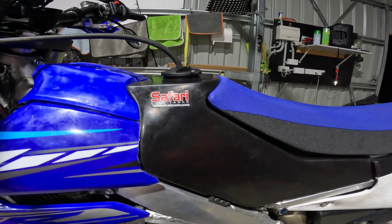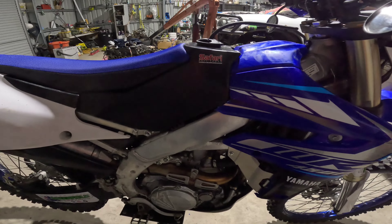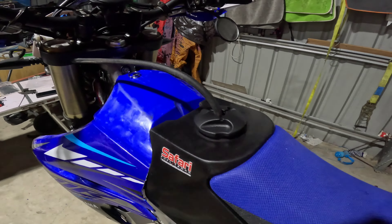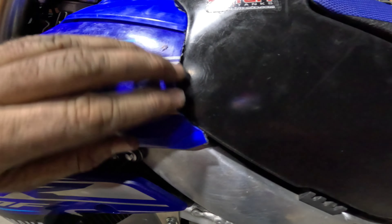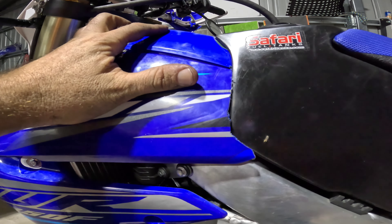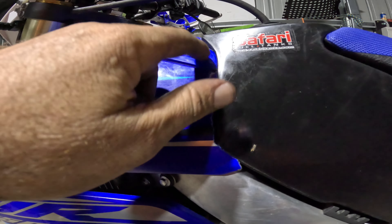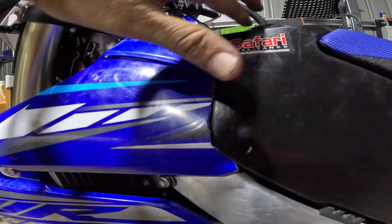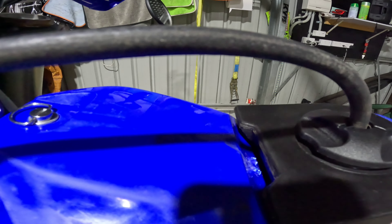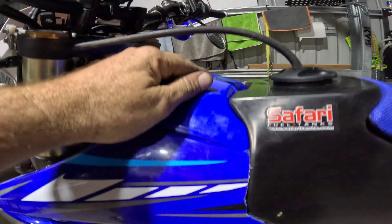There's the final product of it on my WR 2020. I think that looks alright - probably can't tell on this side because it's a bit dark, but yeah, lines up pretty good. Pretty much the same process - I've taken everything off, put it all back together with cutting this up. I will have to cut it a bit more but I just don't have time now, I've got to go cook dinner. On the back of the air filter lid you've got the two clips on either side - had to cut them off to fit because the fuel tank sits hard up against where those clips are. So even if I had this on, the air tank won't lift up to get in there. So I just cut them off, cut the fuel thingy off inside there. I've got my tank bag - it's going to sit on there and hold it down perfectly.